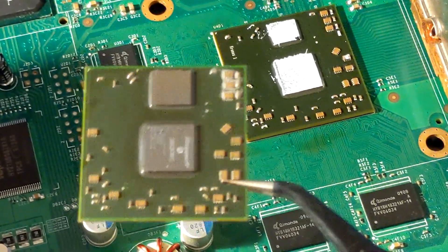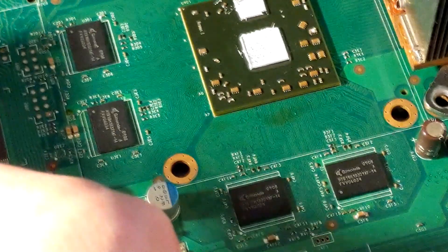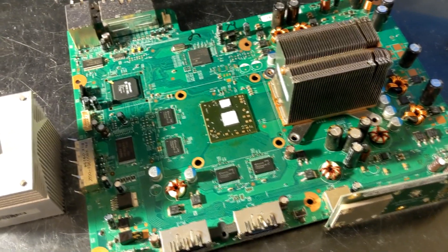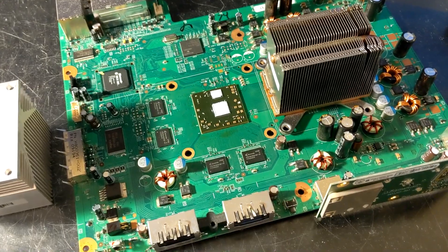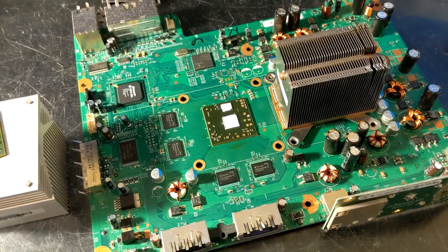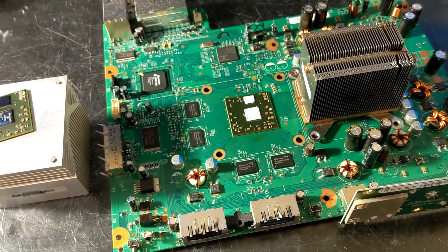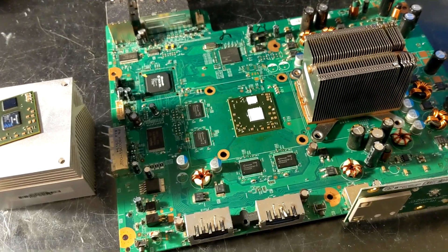As you can see, it's just a drop-in replacement. I don't have to change anything in the firmware or anything for the Chronos GPU to work on the Jasper board. I will point out that the V1 GPU is kept at 71°C versus 73°C on the Chronos, so I actually don't need to edit the SMC config either because having the GPU two degrees cooler is not going to make any difference whatsoever. I'm going to go ahead and clean up all that flux left around the chip so that it's nice and clean, and then we can put the system back together and it's finished.